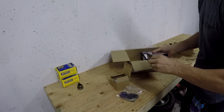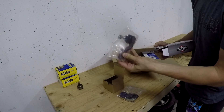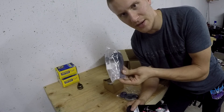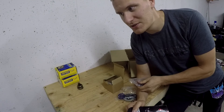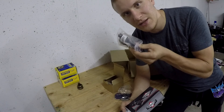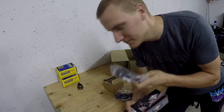We've got another ball joint — I believe this is the lower ball joint. Oh no, this is actually the steering control arm. Very important to replace these because they've also seen a lot of abuse. If you want to make sure your suspension works really well, do replace these. I'm not sparing any expense — and mind you, these aren't expensive. This is like 15 bucks. We don't have a huge budget, especially since YouTube pretty much demonetized everything, but spend the money where it matters — suspension and handling.